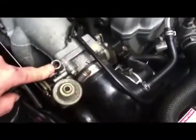Now to adjust your idle speed: the idle speed stop screw is under the back. There's an eight millimeter bolt back here under the dashpot, with an eight millimeter nut and a two millimeter Allen key on it. You shouldn't have to adjust your idle speed generally, even if you're bumping your timing up and down - as long as your base timing idle is at around 950 to 1000 RPMs you should be good. When you bump up your timing the idle speed will go up, and you want to leave your idle speed up where the timing is bumped to. A lot of people cheat and use the idle air control screw up top - I have to admit I do too, because adjusting the throttle stop screw down there is a royal pain in the ass.